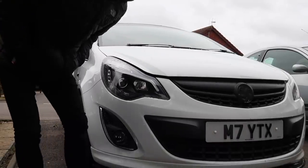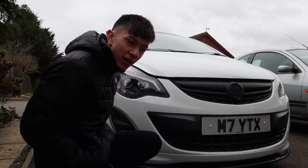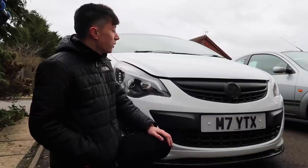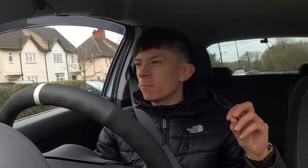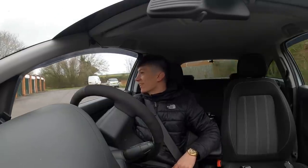The brake change is now completely done. I've taken it off the bricks and driven it. Slight problem — they feel a bit spongy, like there's air in the brakes. I'm not sure how it got in, I only had the master cylinder half open for a short time. We're going to go for a little drive down the road and see. The brakes do feel good overall, just that slight spongy feeling. You need to take it slow for the first 400 miles anyway — I'd call that a big success. We didn't die.